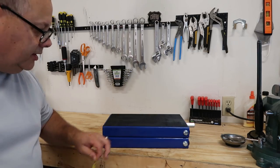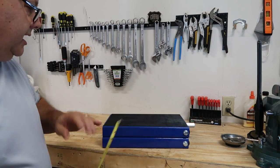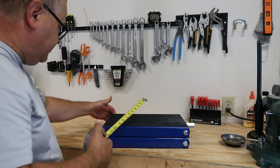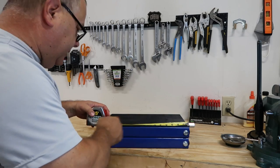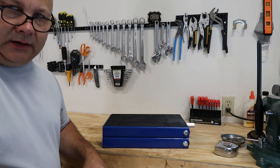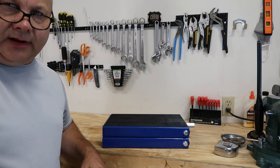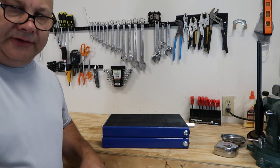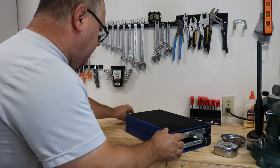Okay, here's the jack. When it folds up, it folds down to like 3.5 inches, something like that. And it's pretty small. The platform is a little over 9 inches if you go all the way to the metal outside, but I think the platform is set up to be about 9 inches by 14.5. Plenty. Now again, I use it on my 2021 Harley Davidson Sport Glide. That bike, I think wet, is around 700 pounds. This is rated for like 1100 pounds. Has no problem lifting that Softail Harley Davidson up whatsoever. It's a good size, and it couldn't be simpler.